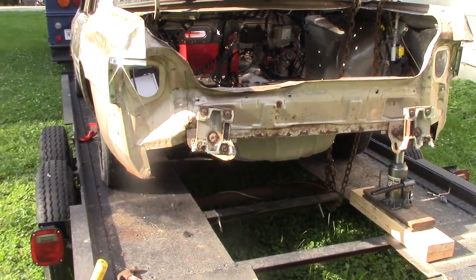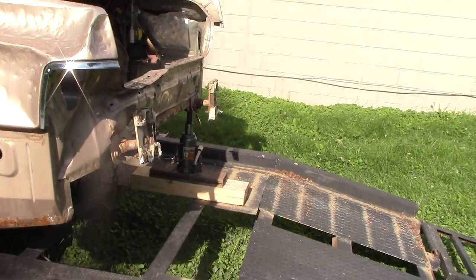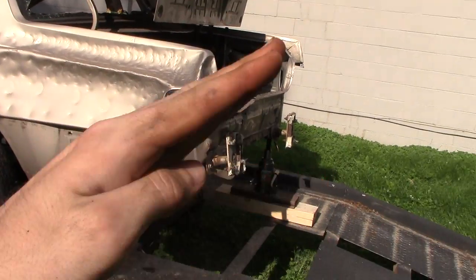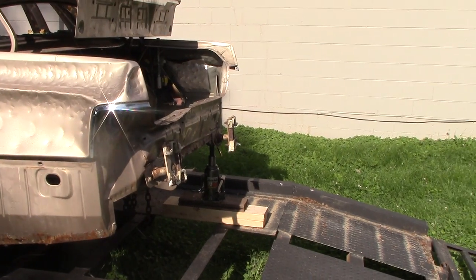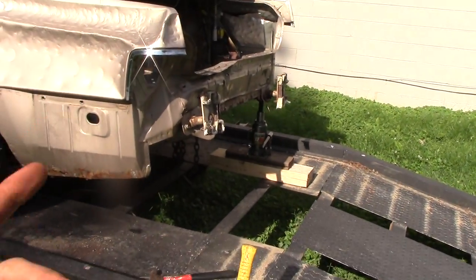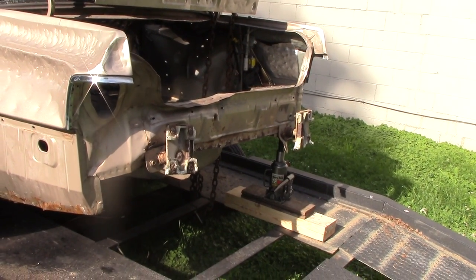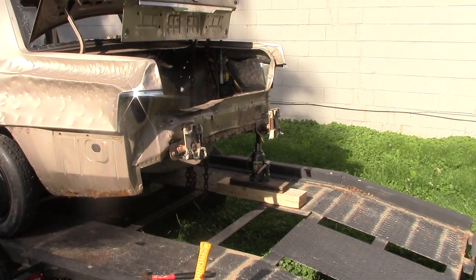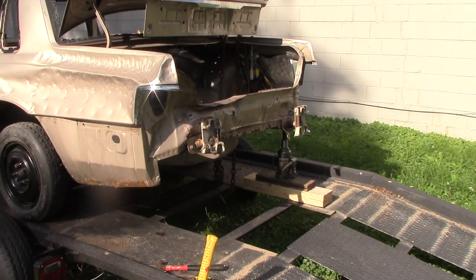Let's quickly talk about the basics of unibodies and pre-bending. My usual setup for most compacts is to remove the back bumper, tuck the trunk, and pre-bend the rear. I do this because that is pretty much the 100% safest way to guarantee your trunk will go up and pack in. By having the trunk lid and the frame pre-bent, I take the bumpers off because I don't want that much strength going to my frame rails and pushing them down — I'd rather the body just smash into a big ball. Certain compact cars you can leave the bumper on in the back; it depends on the car. Any car that is known to plow in the back, or if you don't know, then remove the back bumper.